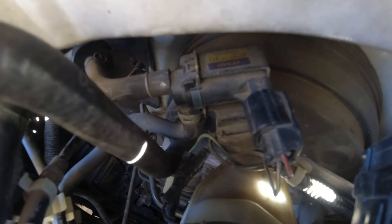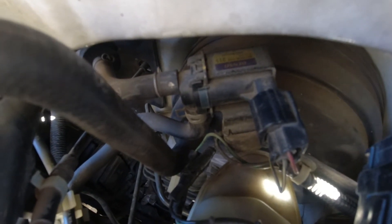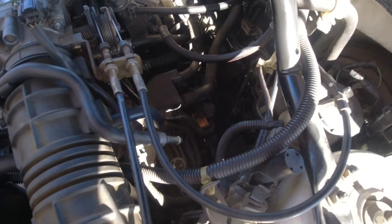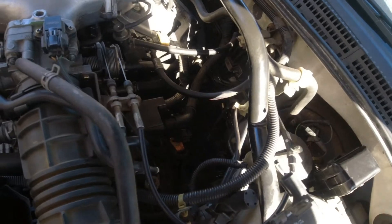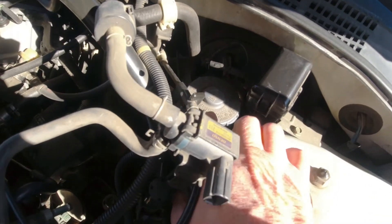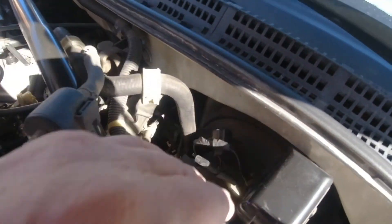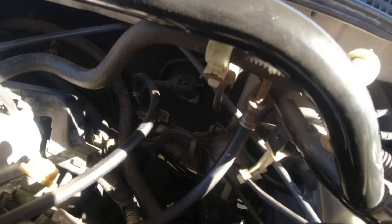Let's take that out and give it a test to make sure it is not leaking engine vacuum as a possible source of rough idling. In order to show you the throttle body, this hose here — that's where I disconnected it. So this goes to this hose here, and it sits in the car just above your brake fluid cap. It's right here, and there's one push-on connector here that we pulled off. I'll just squeeze it and pull it off. This end connects back here on the firewall — that's how I pulled it out.